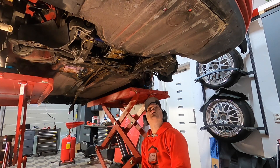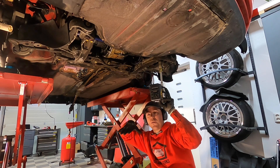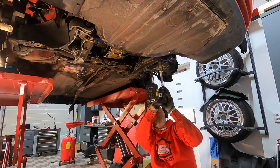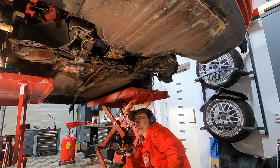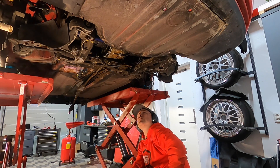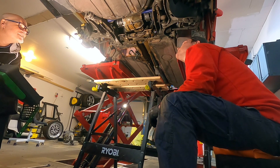First time for everything — we're going to release some of the bolts on the carriage here, put a table here, then lower the car down, release it completely, lift it onto the table, and then lift the car off. I believe it's all loose now. We've released the suspension to the uprights and taken down the ABS sensor cables as well. So let's just put the table here. Jan-Irik just asked me if we thought about everything, and I'm sure we haven't — so let's try anyway and see where we get.